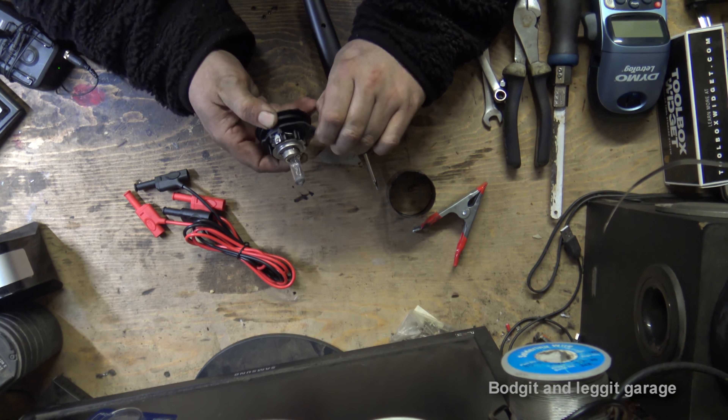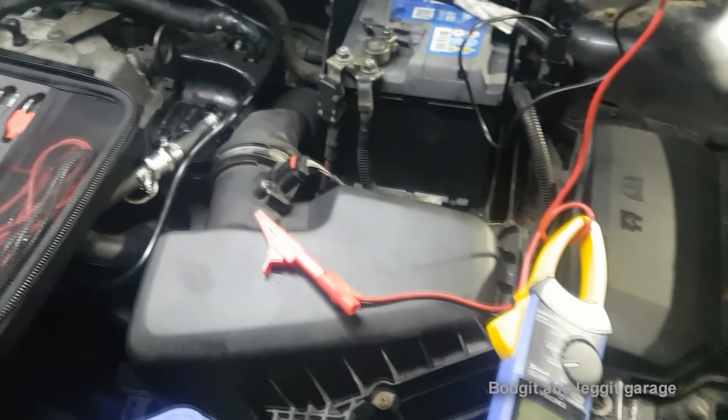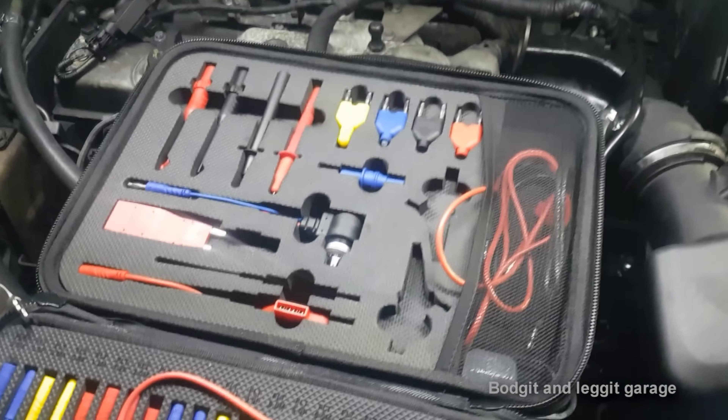It's clipped, it's out of the way, not going to burn anything. You can easily wrap it up, you've got your special end so you can use any connection. If you're doing something heavy on a car — fan motor, testing lighting circuits — you need a good heavy draw. If you need more than a 4.4 amp draw, I can plug my other test leads in here and make it a bigger draw. That's why I like using these double connections — you can slot in another test light and go up the amperage if you need more draw.